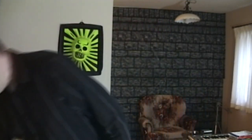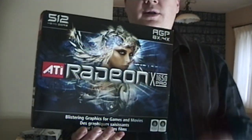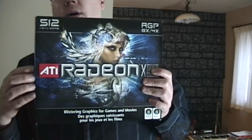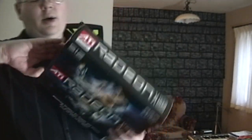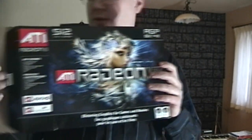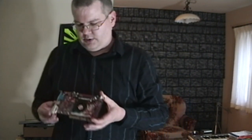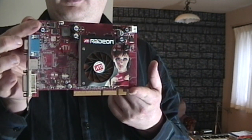For a while I had that one plugged into the Athlon system, but it wasn't long before I realized this just isn't cutting it — it was really slow. Forget watching any kind of high-definition content. So a couple years ago I upgraded to this beast, because the Athlon system actually has an AGP slot, which of course is for graphics. I thought, oh yes, I can finally make the leap from PCI to AGP. And holy crap, what a difference. I was actually really lucky to get this, because at the time PCI Express was basically taking over for graphics cards.